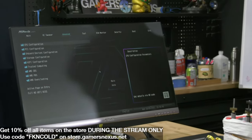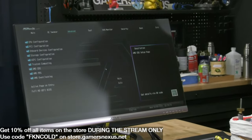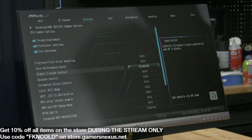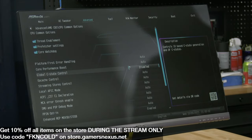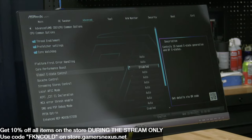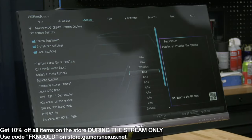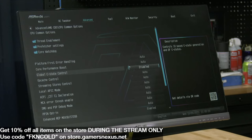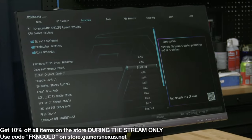In the advanced AMD CBS menu under CPU, I'm going to disable global C-state. C-state is x86 power management - when it executes the halt instruction, we go into different C-states. The first is halting the clock; eventually you can power down the core. When doing LN2 overclocking you don't want any play with power states - power gating tends to be bad. This is also true for the iGPU running the display and for discrete graphics cards in a feature called graphics off.